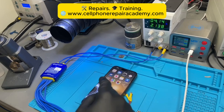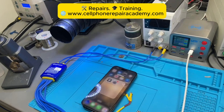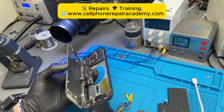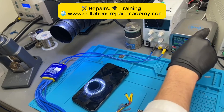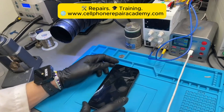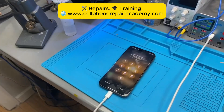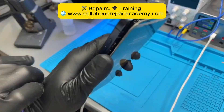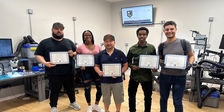The root cause? That USB port on the couch likely sent unstable power, damaging the U9500 and U4000 ICs. This isn't just a weird one-off issue — we're seeing more and more iPhone 15 Pro and Pro Max devices damaged by third-party USB-C chargers, especially ones made for older Android devices or built into furniture. Would you trust your $1,200 phone to a couch ever again? Drop a comment and let us know.